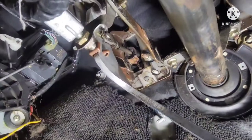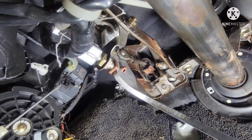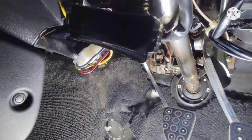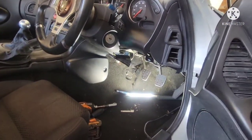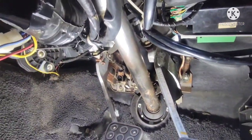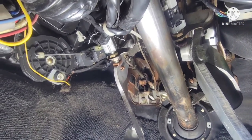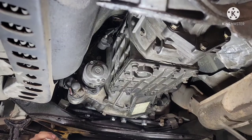Just running back to make sure those two nuts are tight — you don't want to do this job again because there's no room down here to work and you're on your back upside down. This is one hell of a job. After everything is nice and tight, be sure to put that clip on the rod if you took it out. After that, let's go under the hood and bleed this thing.